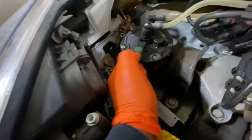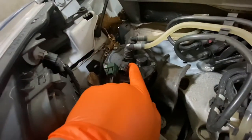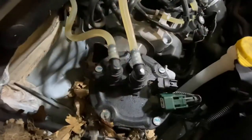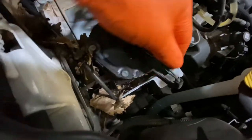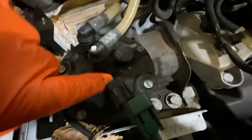And then first what you need to do is unplug it like so. As you can see, these little clips here have got colors on them. You need to push that side in and also push that side in down there, and it's the same on this side. I've already unplugged it. You need to unplug the switch. You literally just push this clip in and it just comes off, and there's a little green colored bit there. You need to push that side in.